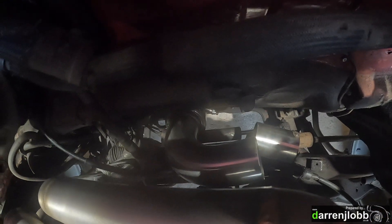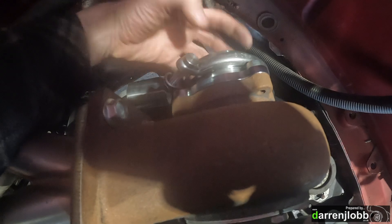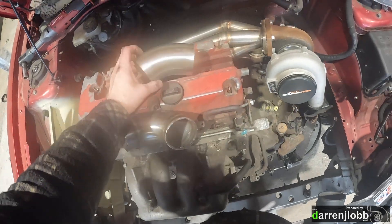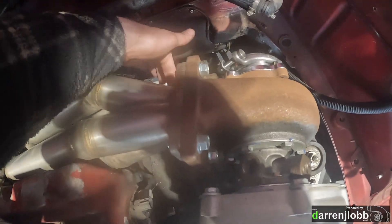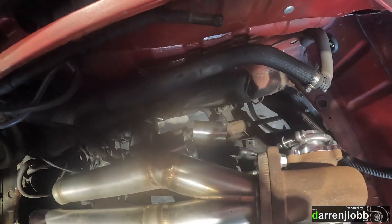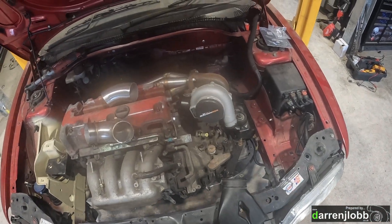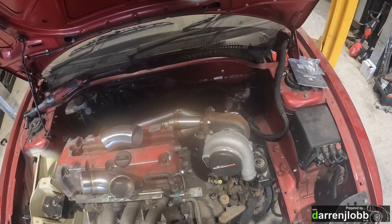We've come up through the tunnel there now, with a 90-degree bend on the end. There's an adapter flange here that bolts to the turbo and ends on a three-inch V-band so we can adapt to that. We're basically just cutting some pieces to fill in this gap now. I'm going to come around straight and then down slightly. We've got to bear in mind the gear linkage cables have to go through there as well, so we want to keep up above them. We're going to cut some tube, tack everything up first to make sure we're happy with it, and then final weld it at the end.